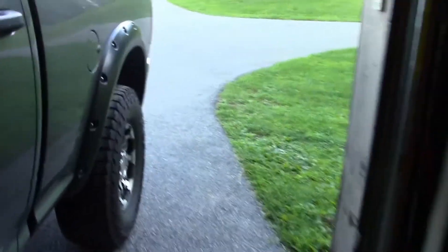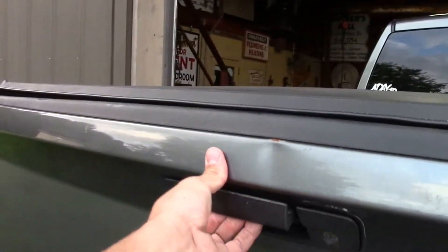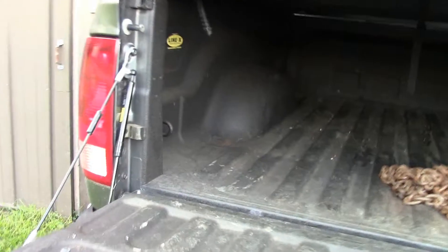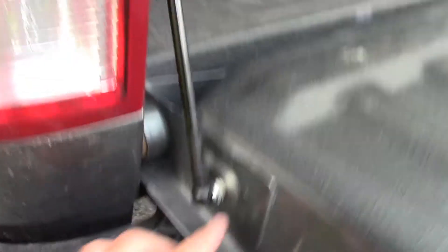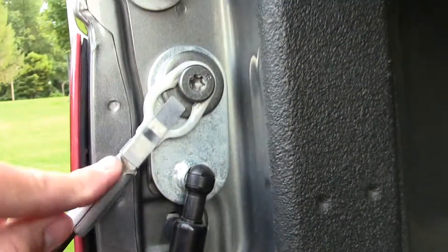First and foremost, if you have a fourth gen Ram, I will tell you right now, you need this — a tailgate assist. If you own a fourth gen Ram, go on Amazon and look at the DEE ZEE, DZ brand tailgate assist. It's very simple. There's a little thread-in nut that goes in here, and then this threads on the end of it, clips on here. You take this bolt out, take this cable off, this mounts right there, and that goes on there. It's as simple as that. No more slamming tailgates — you all know how light these are, and when you open them they just go bang. This is a necessity. I'm telling you right now, gotta have it.